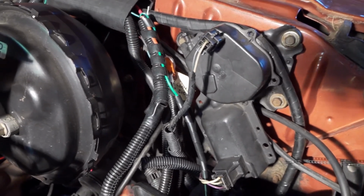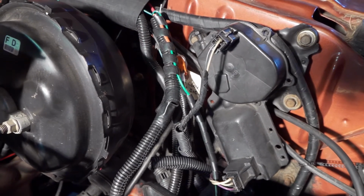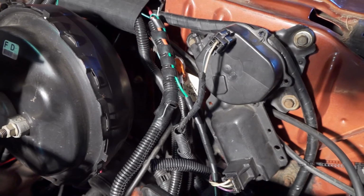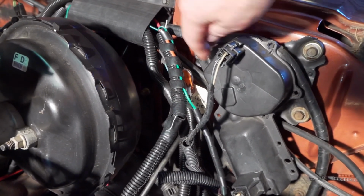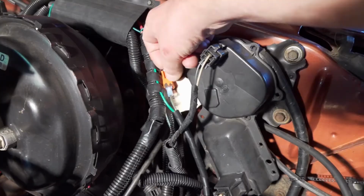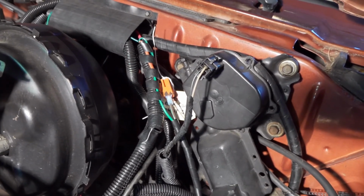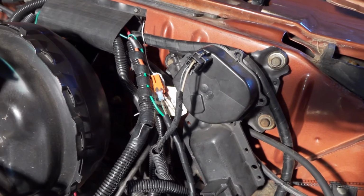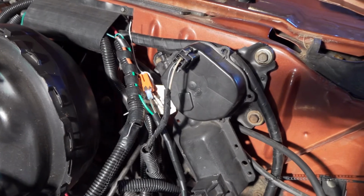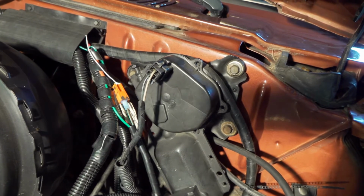One other item of interest here, and you may be wondering, where did you get the signal to turn on the green light on the dashboard when the transmission goes into lockup? Well, it turns out there's an orange plug that's been laying here. It's directly wired to the torque converter vacuum switch, and all I can guess is it was a way to hook diagnostic equipment into it to test the circuit. And anytime there's 12 volts there, my light will light on the dashboard.